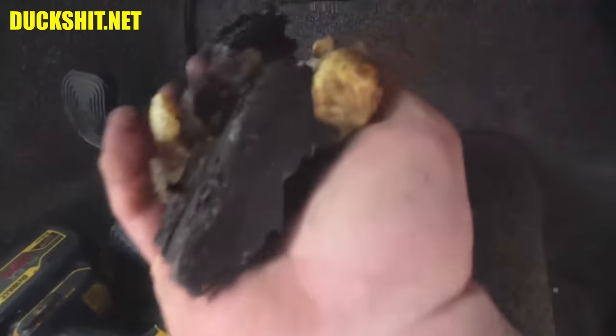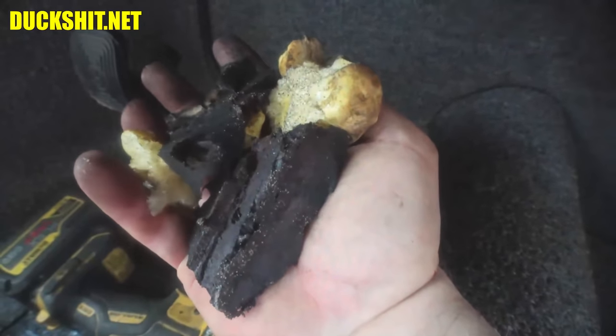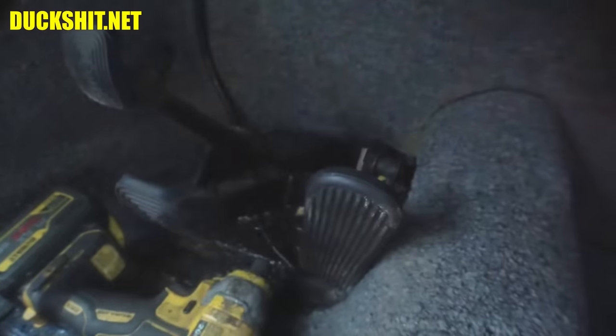Okay, as I went in here to adjust the pedal cluster, you notice you can see some daylight. You're not supposed to see daylight down there. There's a hole about the size of a silver dollar underneath the pedal cluster. And when I was looking for that 13 millimeter bolt so I could raise this brake pedal up to where it belongs, I discovered all of this. So this was covering that rust hole. It looks like this is its little skeleton in the closet.